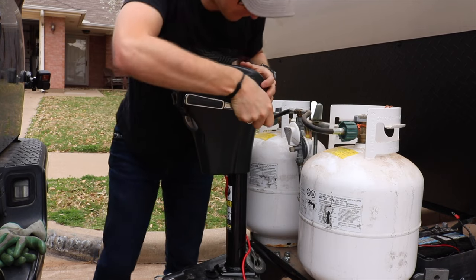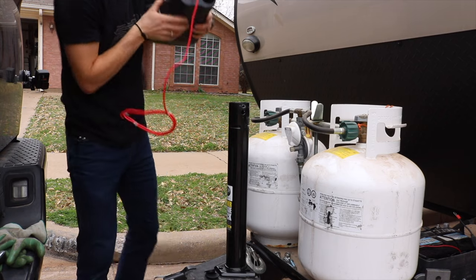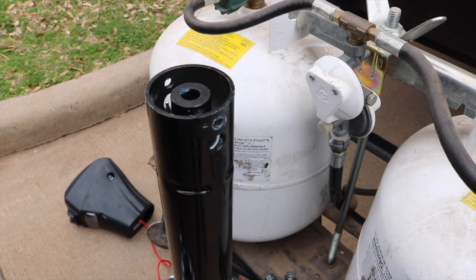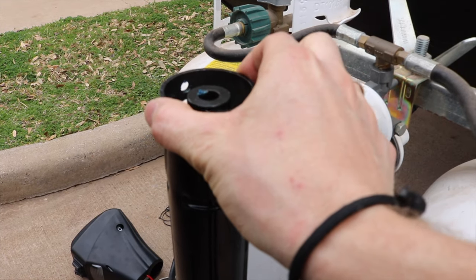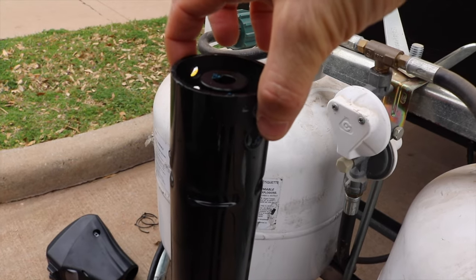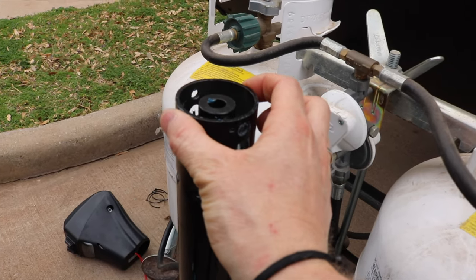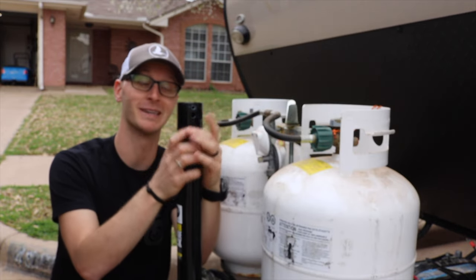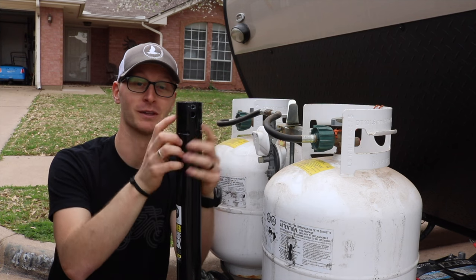The bolts are half inch. Now we should be able to just remove the entire head and motor assembly. The research I did on this jack — all the pictures I saw showed that these two top holes were also here as blanks, just untapped holes. That's what we're going to do: rotate it 90 degrees and tap those in. It's not going to make a difference because we'll just drill two new holes right here, since they were going to be two empty holes we'd have to tap anyway. I'm going to take this off so we can tip it and not get any shavings down in that screw. Apparently my version does not have the pre-drilled holes, so yours may already have them — just take the head off and figure it out. If it doesn't, you're going to have to drill a hole.